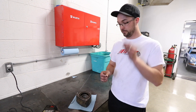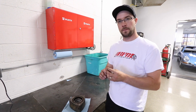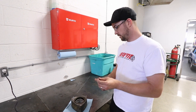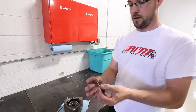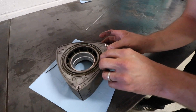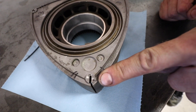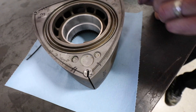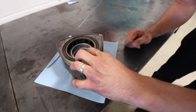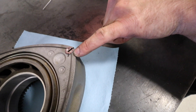We promised you some secrets and tips on how to clearance side seals, and Joe's going to give us a little lesson on how he does it. New Mazda side seals come extra long. If I put this down into this side seal groove here, you will see that it does not fit down into that corner — it's too long. So we've got to machine this down. Now you can see on this end how it fits nice and tightly to that corner seal.